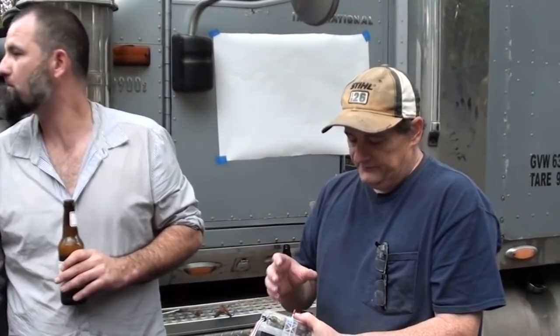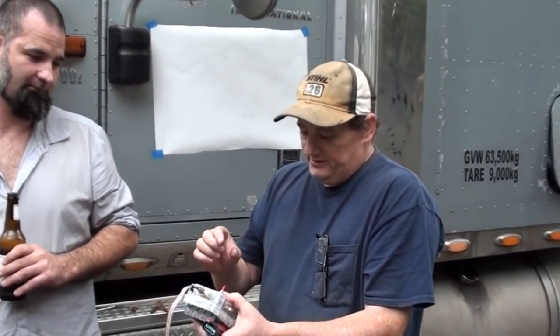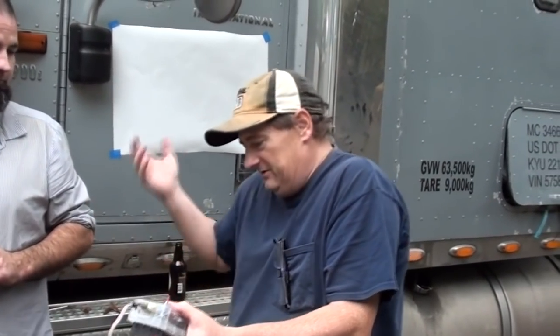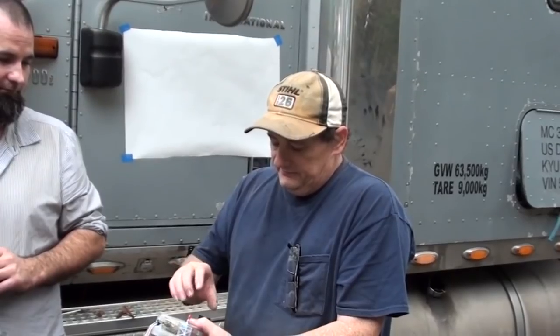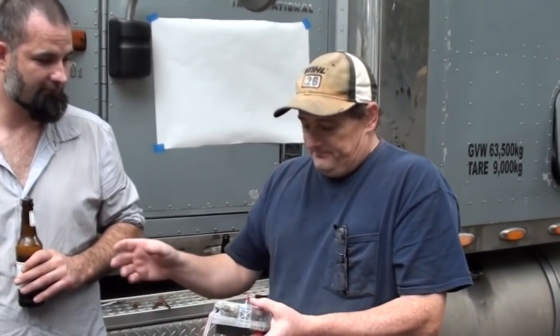And this thing's got a little teeny tiny display. But that's what I had laying in a drawer, so it's what I use. I could have used a bigger display. But what it does is it's got a couple modes where you can turn the knob and it'll follow you. The motor inside will follow the knob. It's manual control where you can move the vanes in and out of the turbocharger, either with the engine running or not.